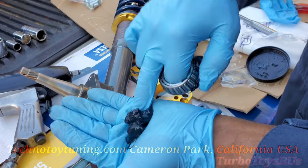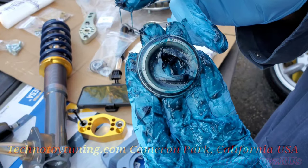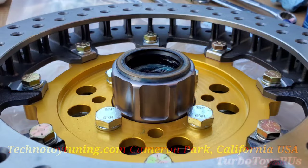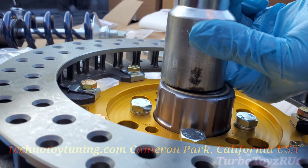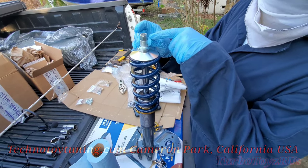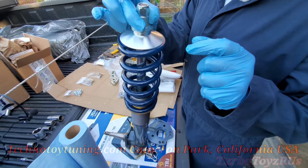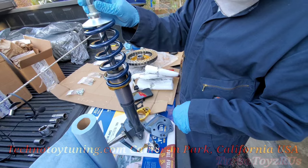Get some grease, drag it in your hand, and you can start forcing it down in there — fits perfectly on the seal. These coilovers come with AGX KYB inserts and they're adjustable. You have four settings. The kit comes with a small flat screwdriver so you can effect the change that you want with your ride.